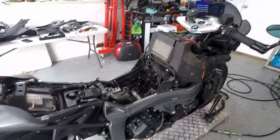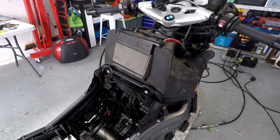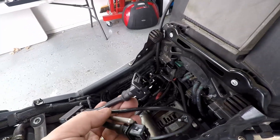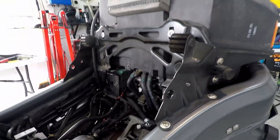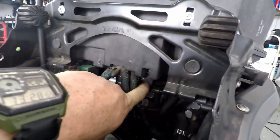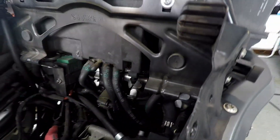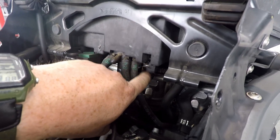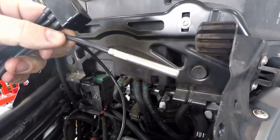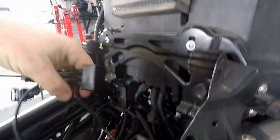For the installation on the K — I've got the tank off and all the plastics, those are a separate video — but basically what this is is a two-pin connector which interfaces and takes the signal from the intake air temperature sensor in the airbox, which luckily for us is right here. It is a two-pin wire, and that lets you intercept the signal coming from the intake air temperature sensor. It then compares that to its own air temperature sensor reading, which we will zip tie to the intake somewhere over here, to get a similar reading to what's coming into the bike.